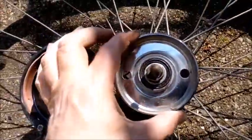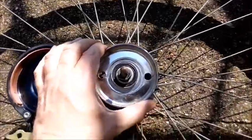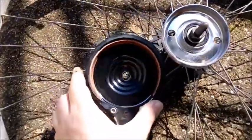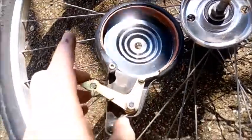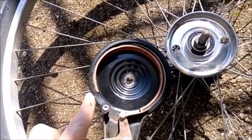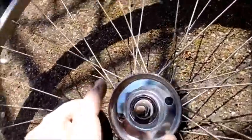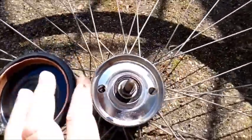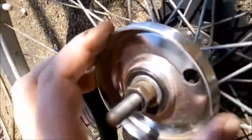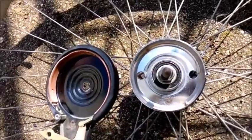You've got this drum which sits on the threaded hub of your bicycle wheel, and the band brake is held in that black outer casing. The actuating lever simply reduces the diameter of the band giving the braking effect. You want to make sure this is all clean inside — no bumps, rust, corrosion, or wear on the drum. This one is practically brand new. Make sure there's no grease in here; keep it dry, dust and grease free.